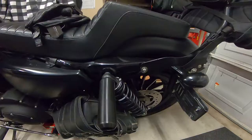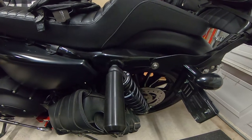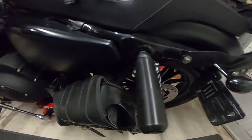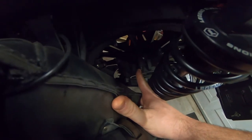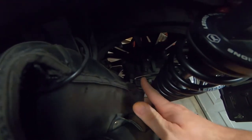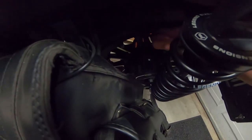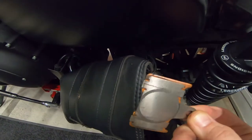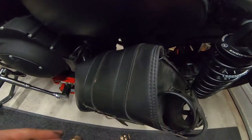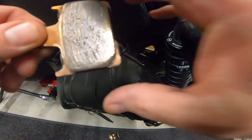We're over at the bike. I'm just going to pull the brake pads off quickly. Using an eight millimeter socket, take this bolt out right here, pull this little clip off, and then the pads will just come out from the top. First brake pad out, second brake pad out. We'll go over to the bench and discuss this further.